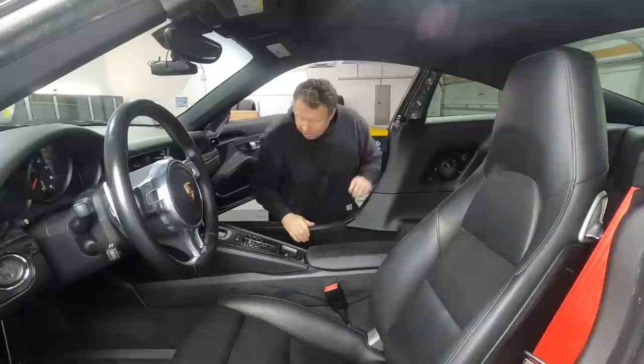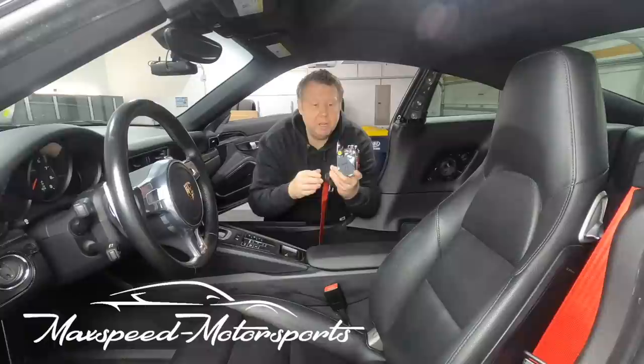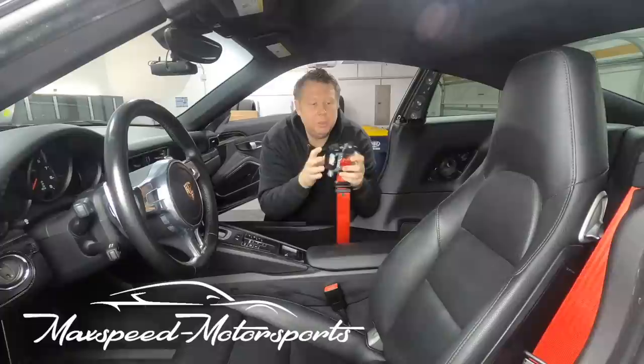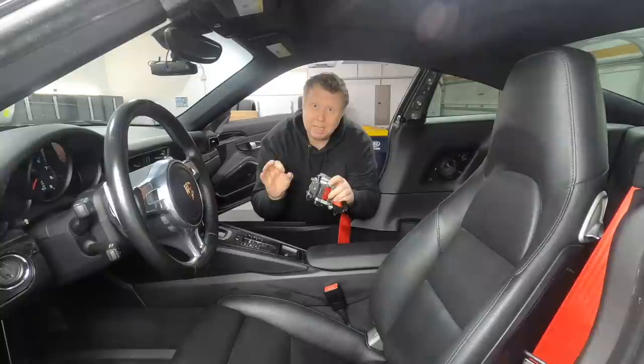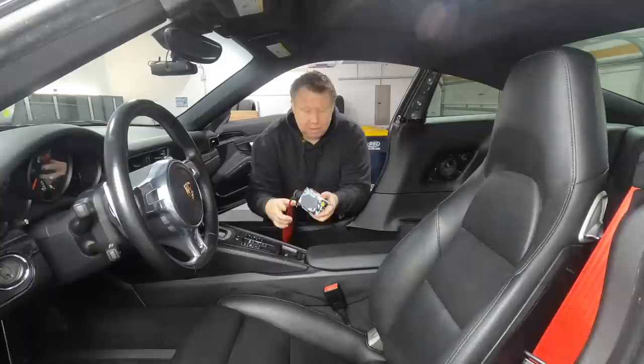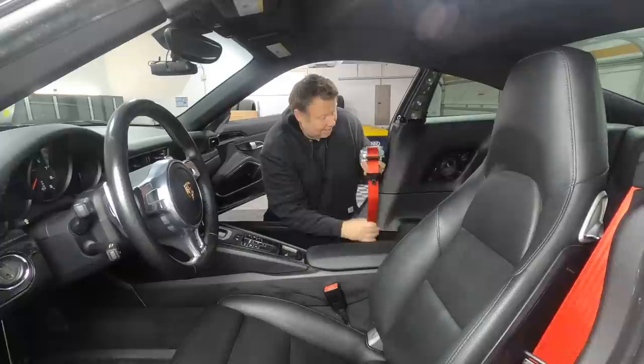And then let's just get to the main event. Here's the seatbelt itself, back from the store, back from MaxSpeed. So here are the two wiring harnesses I was talking about. One's blue and one's yellow. Very similar to the plugs that are in the back of the airbag in the steering wheel and other important electrical safety connections in the car. So some kind of safety feature. This bolt here holds it into place down here. And then this ultimately feeds up through the top, comes down and gets connected to the side. And then this guy here connects to the top.